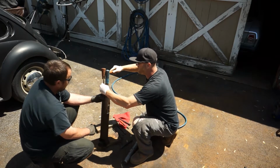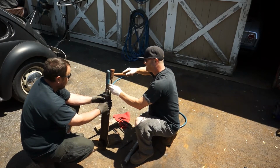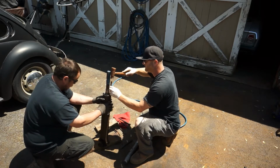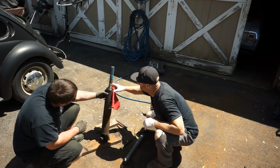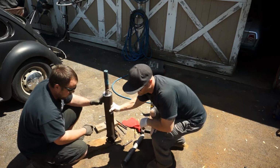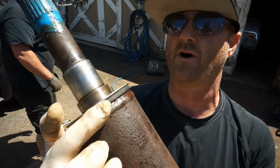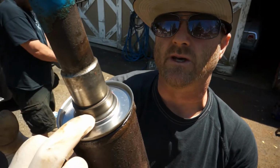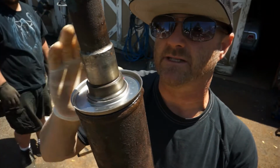And you can hear it bottoming out right now. The tapping's getting more dense. It's not as tingy. It sounds pretty seated to me. What's it look like, Gene? We can show them what that looks like here. You can see on that one, it's seated all the way up, butted all the way up. And we just went around the inside here at first with the awl turned upside down, and then later I ran it right in this middle seam until it bottomed out.